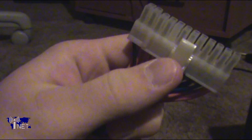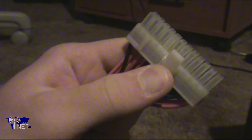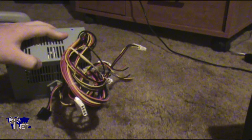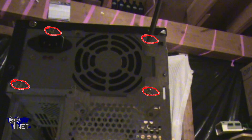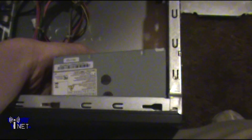Note that many power connectors, especially the ones that connect directly to the motherboard, have special tabs on them to hold them in place. If the cable doesn't simply pull away, make sure you look for one of these tabs and pull it back to avoid damage to either the connector or the component it's powering. I find it's helpful to bundle the cables of the power supply together with a rubber band, just so you know it's all going to be in one place. At this point, you can go ahead and remove the four screws at the back of the computer case which hold the power supply in place. After these are removed, the power supply should simply lift out of the case.